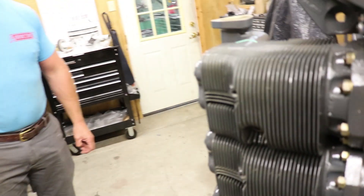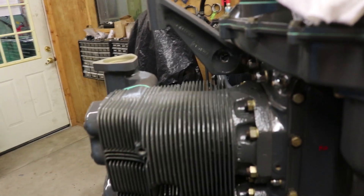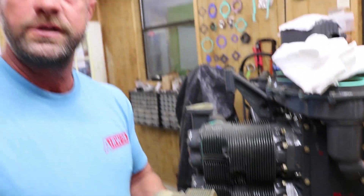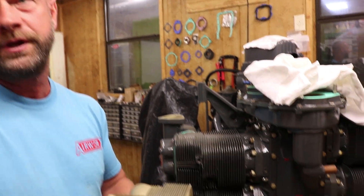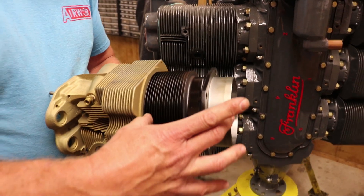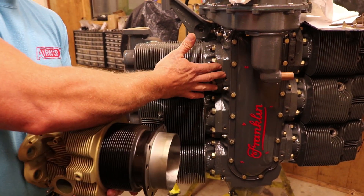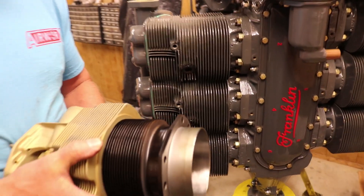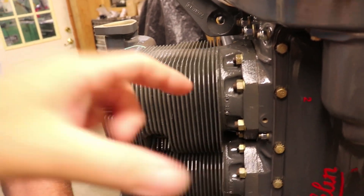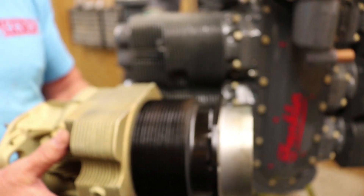This is a TSI 360 Continental cylinder, very similar to Lycoming cylinders. The lower half of the Continental cylinder is actually screwed under heat into the top head section. The Franklin, by comparison, is just one solid unit — it's just got a replaceable liner inside. And side by side, the number and thickness of cooling fins is practically doubled on the Franklin, giving twice as much cooling area, which allows those cylinders to run good and cool.